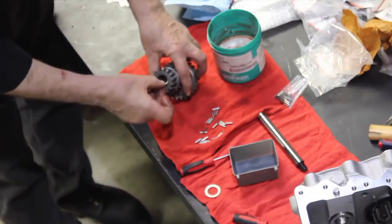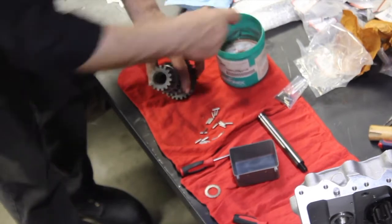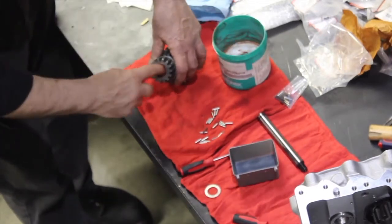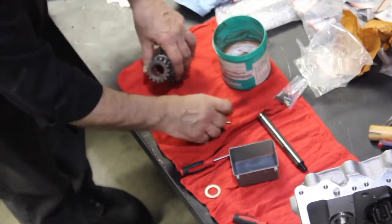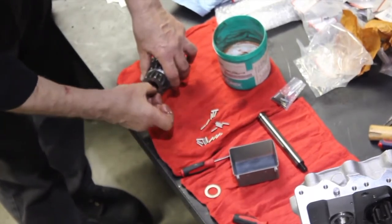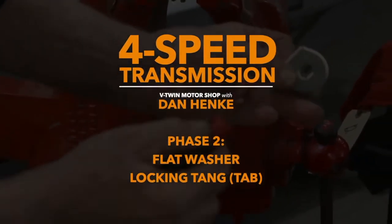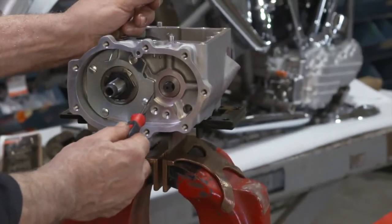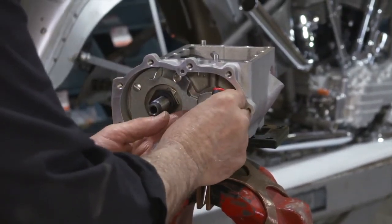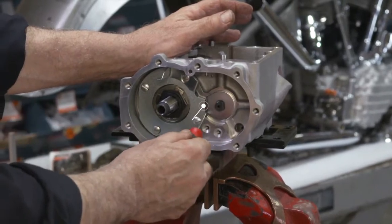Inner thrust washer against the retaining ring inside. And we start running our rollers right in again. And again, these are standard rollers, 125 thousandths, which must locate in this flat right here. Now, this flat on the exterior must align with the flat on the main shaft plate. So that's the key. He had to turn that shaft 180 degrees so that both flats are parallel. See how that acts as a lock? That locks here, and it locks here on the countershaft.